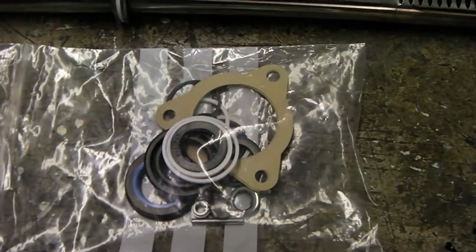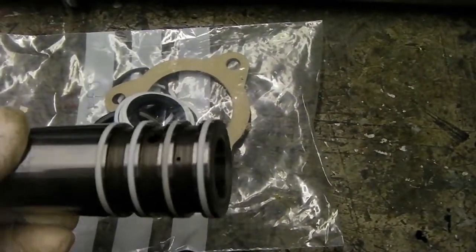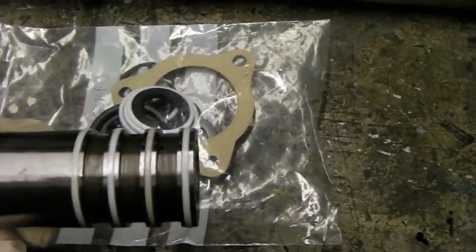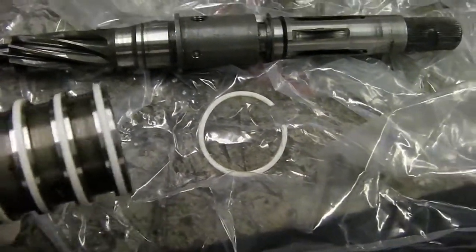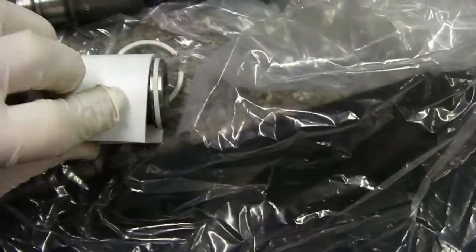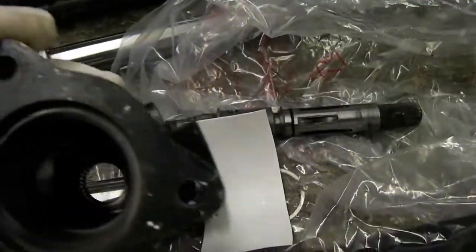The seals have arrived today from Cardi Clinton in Birmingham. It includes white PTFE seals, which are the essential ones for the tower seals. These can be quite difficult because they're square section seals and they're quite tough — I find if everything's nice and warm they go on a little bit easier. When you get them on you have to wind them on a little bit with a screwdriver which makes them go a bit baggy. The solution I've found is a piece of plastic from a 5-litre container — I wrap it round, put a jubilee clip around it, wind the jubilee clip up slowly to recompress the seals, fit them back in the tower, and then they reform to the new shape.